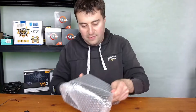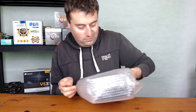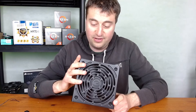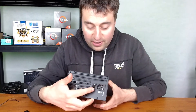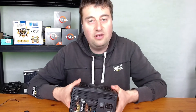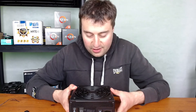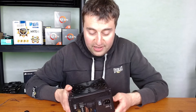Let's take a look at the actual power supply unit — this is a heavy unit, quite a unit! So we have the big 120mm fan as expected, which is really nice. We have the power ratings on the side, the on/off switch, and also an eco mode. If you want to run without the fan spinning you'd put that to the on position for a quieter system. However, for medium to higher-end graphics cards I'd suggest keeping eco mode off — you're going to need that cooling.